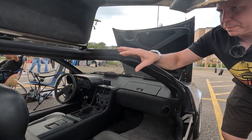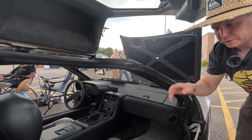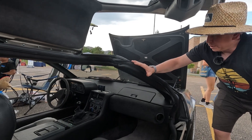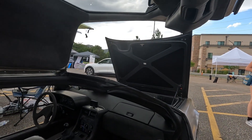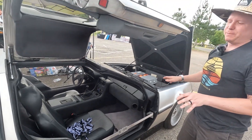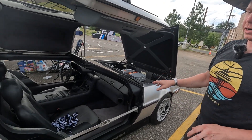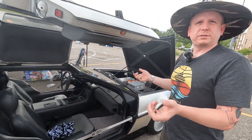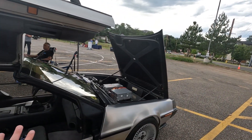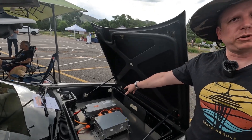The instrument cluster is being driven by my VCU — the tach is showing instantaneous amperage, the speedo works like a speedo, and the fuel gauge is showing battery status. It's very standard-looking and any goodies are all hidden. This is a neat detail for car shows — to keep people out of it, because there are fragile things in the car. Typically you'd have PVC door bars, but I wanted cool little branded bars. The material matches the body — it's all 304 stainless.